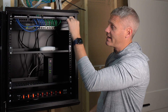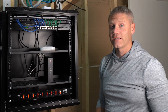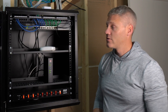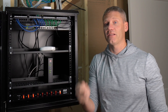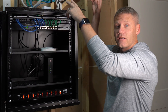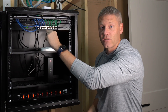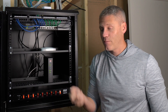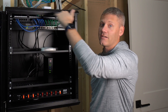That cord — this black wire right here — plugs into this guy, which is just a big switch. Just like that little five-port switch I showed before, it's the same thing, but it has 24 ports. So I plugged one in right here, and now these other 23 ports are usable — plug in a computer and it has access to the internet. All those wires running through the house behind the walls and coming down to this one point — we take those wires and plug them into this switch. Which means if I go to a room where there's a jack on the wall and plug in a computer, it's going to have access to the internet.